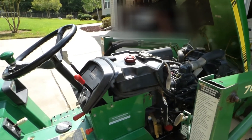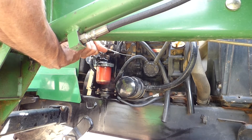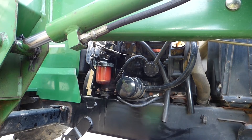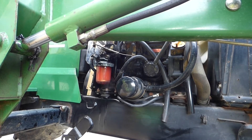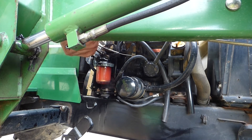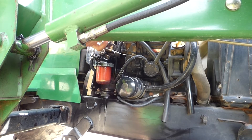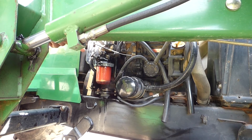We got a little air in the line, so I'm going to have to bleed it. To bleed it, just loosen this screw here — it's a little tight, get a wrench. See the air coming out of there. We'll tighten that back down. Pull the air out of this one — that one looks good. We got air coming out here too. I'll tighten these down and see if that did the trick.